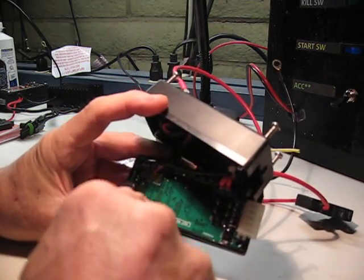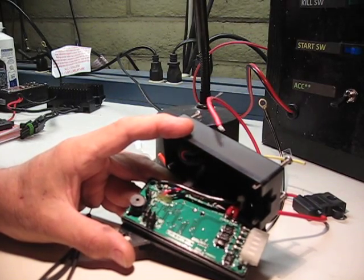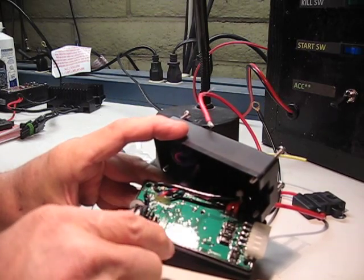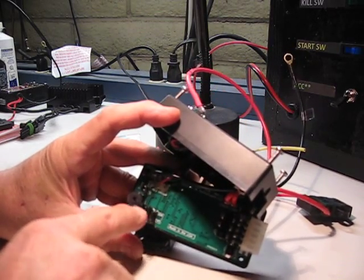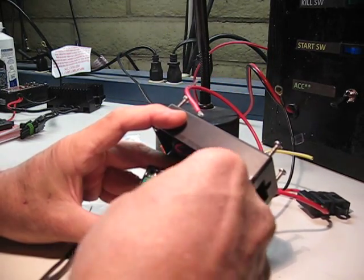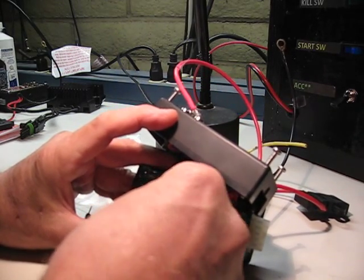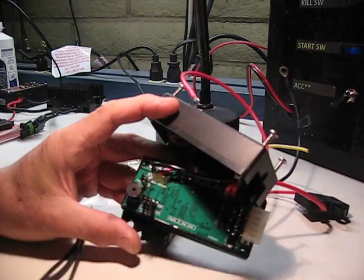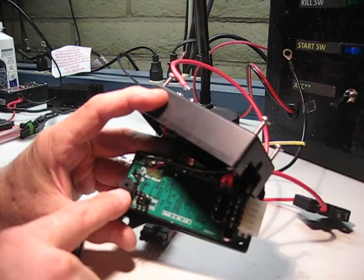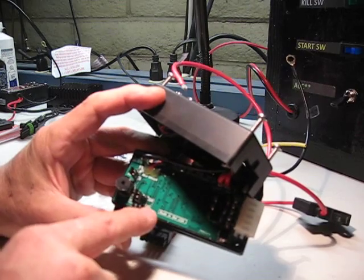There are boxes around these indicating what pair goes together. I'm going to use a pair of small curved needle nose pliers here. So I've just jumpered the upper two. I probably should turn this around so it's clear that these two pair go together. These are just standard little jumpers. They have little tabs on them, so they're a little easier to grab. So the upper two are set to indicate high side control, and the extreme right jumper is for external.